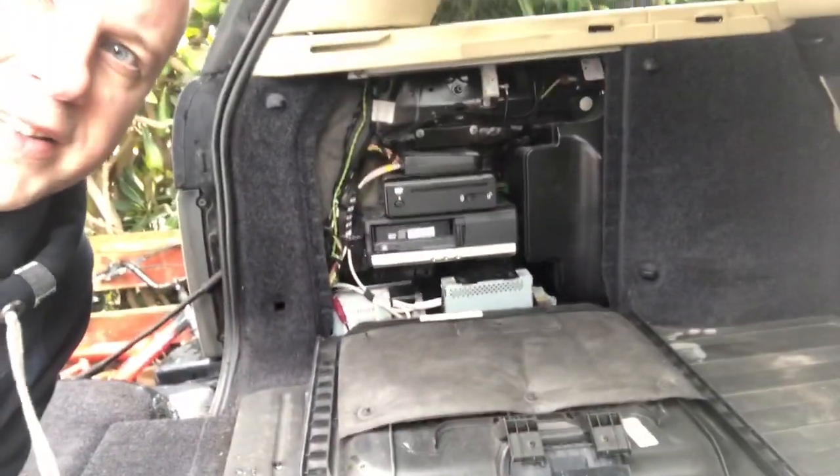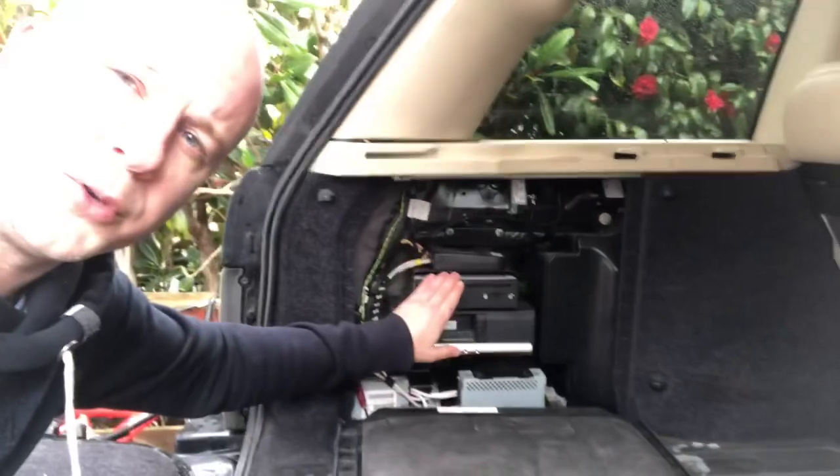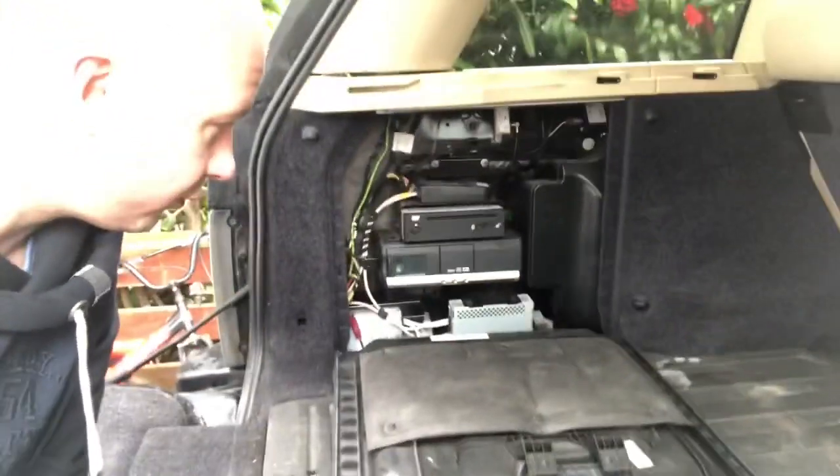All of the electronic wizardry sits in here — in the UK that's the rear passenger side. Once you lift this panel out you can get access to everything in there. Up here you've got phone integration, this is the DVD-ROM for the maps on the GPS, this thing which is playing up on mine is your DVD multi-changer, and then lots of modules down here for all sorts of other things. You're not really going to be able to do much diagnosis looking at that stuff, but you will be able to see if there's been any water ingress, any damage, has it been knocked, has anything been removed, are there any cables flying free. Does it look in good condition? Is it all bolted down nicely?